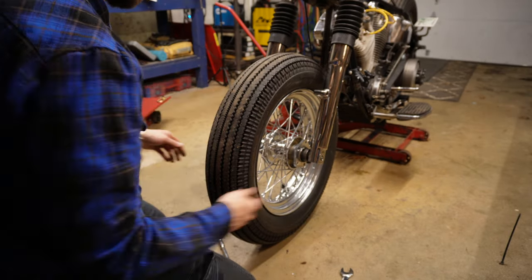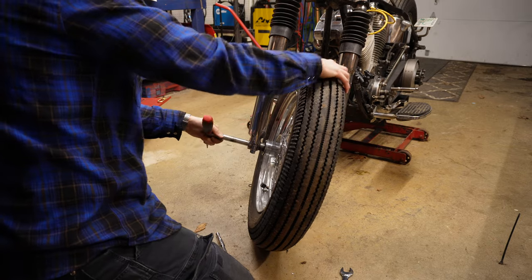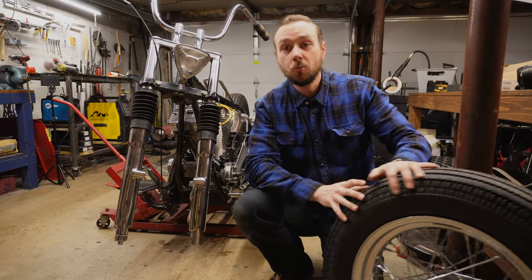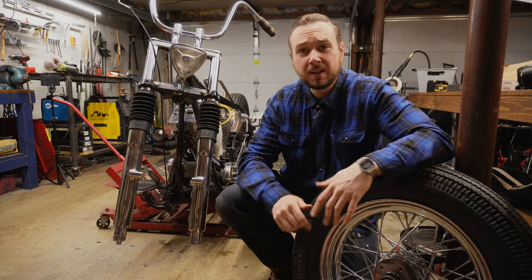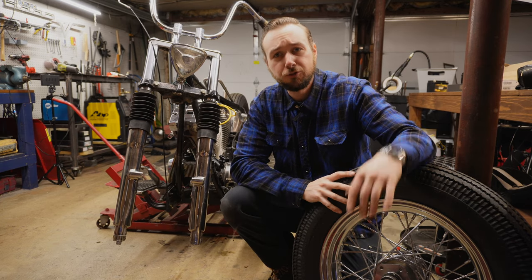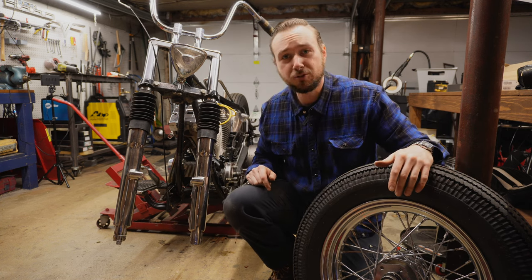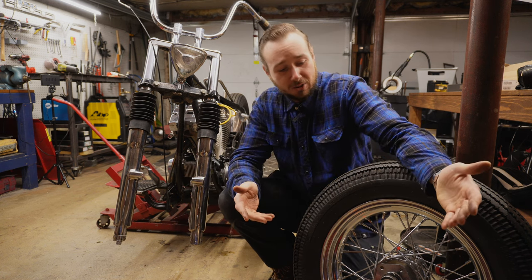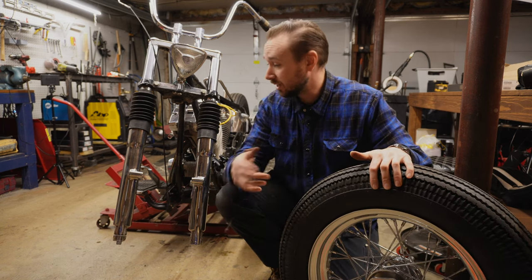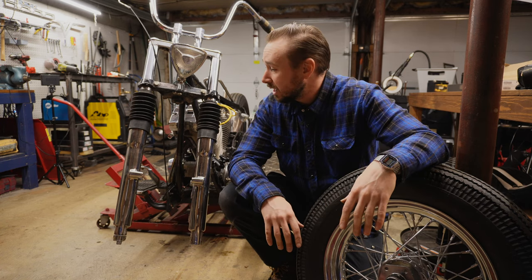You can see the axle already came halfway out. Stick a screwdriver through this side and pull it the rest of the way. One thing I forgot to mention: you might have a front brake attached to your forks. Not something I'm super familiar with as a chopper guy, but if you have one, it would be attached in this region. You'd want to remove that before yanking the wheel out, or at least deal with those cables afterward. Just keep in mind you'll have one extra step in your front fork disassembly.